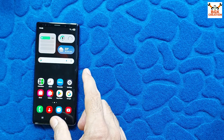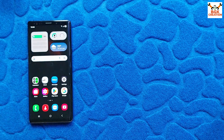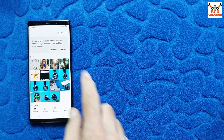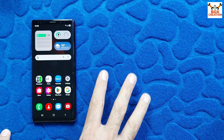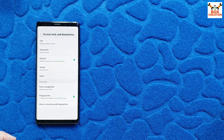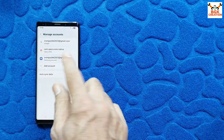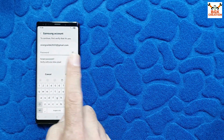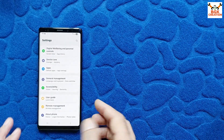First of all, your Galaxy Note 9 must be updated to the latest stock firmware. Before starting the procedure, you need to save all internal storage data because it will get formatted. Check the battery — it should be charged above 30%. Turn off the lock screen by selecting swipe. Remove biometric data, remove your Samsung account if you are using it, and sync then remove your Google account to avoid issues later on.